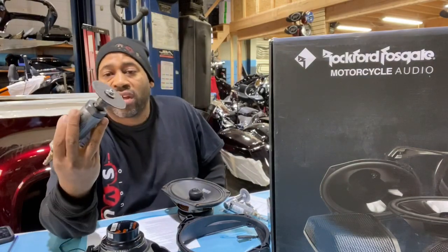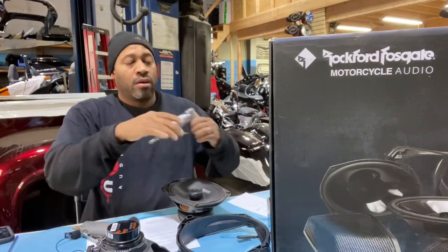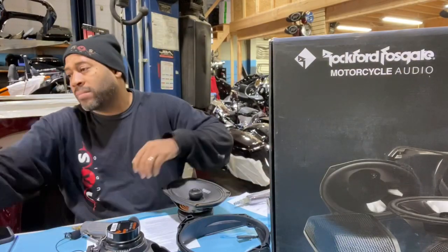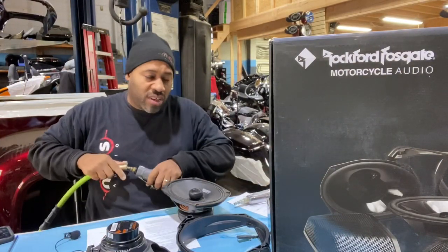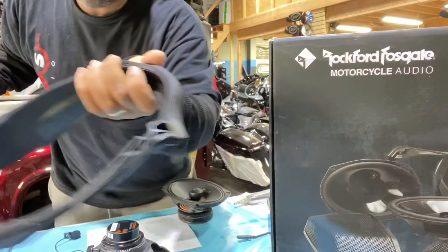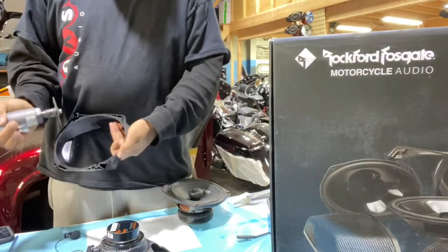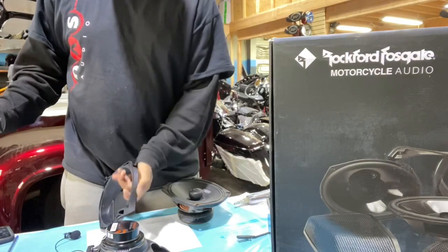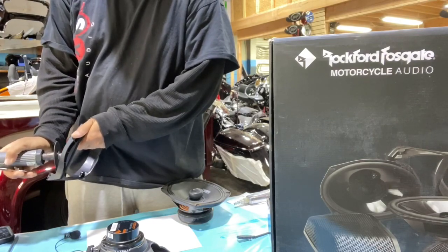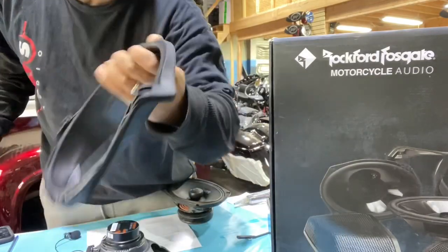Okay, this is a standard Snap-on die grinder with a 3-inch cutoff wheel. This is what we normally use. Or you can use a right angle grinder with a solid disc. Modification only takes a few seconds. So first thing you want to do is grind that nub off, that one right there. So now you can see that's flat, so the speaker will sit flat.